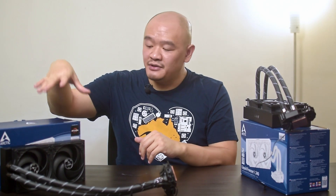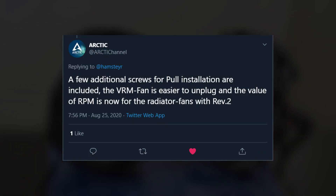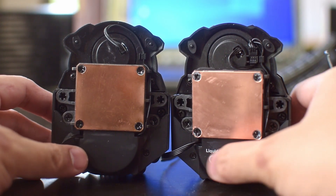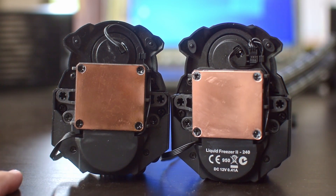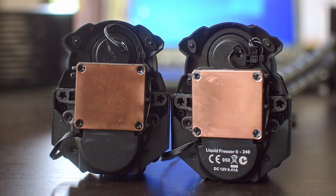While I'm happy that my findings are now in line with what other YouTubers are getting, I'm also extremely curious as to what has changed between my faulty Revision 1 and the newer Revision 2, and whether any of these changes fixed the issue I was having originally. I asked Arctic over on their Twitter account, to which they replied, but I also noticed several other things that changed. Starting with the pump block, we immediately see printing and marking differences on the plastic housing, and looking above, the cable for the tiny VRM fan — previously a plug header directly soldered onto the PCB — is now a cable with the plug in-line, with slight differences in the routing as well.